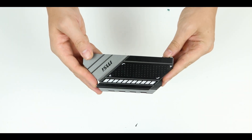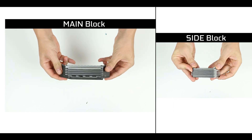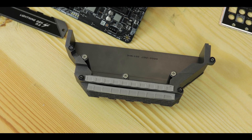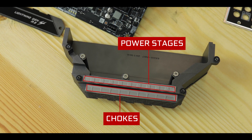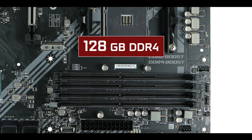We have a massive single heat shield cover design, introduced on the much more expensive MSI X570 UniFi, running from the power stages all the way to the back I/O — nothing but condensed steel topped by a never-ending radiating roof, no RGB, just pure utility. Both heat shields have double thermo-padded contact design providing individual heat dissipation for both chokes and power stages. Combined with the 6-layer PCB, this gives us one of the most heat-efficient VRMs on the market today.